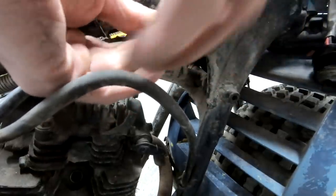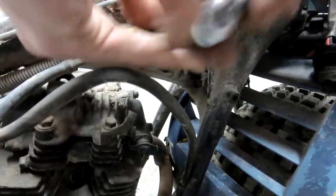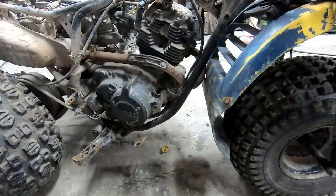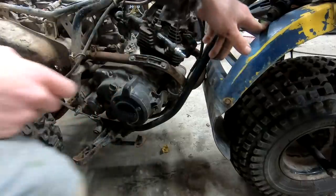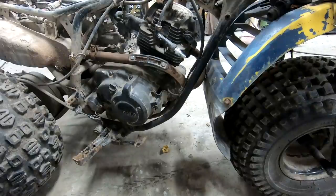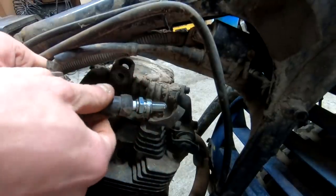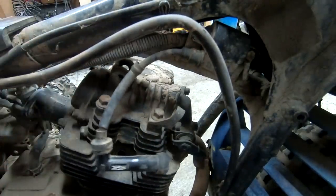Hopefully this fixes it. The new coils are dirt cheap, which is cool, but this is now — that's a few days from now — so this is instantaneous satisfaction. Grab my spark plug, throw it in this guy. Neutral light is on, spark grounded. Oh yeah — spark for days! Brand new spark plug too. We're ready to rock and roll.